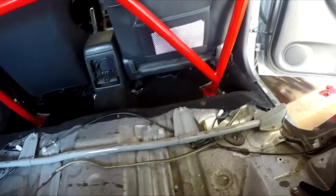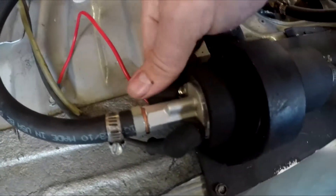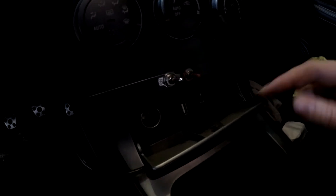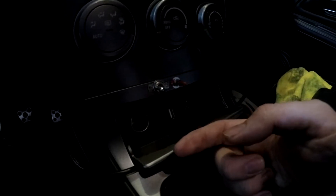When I got the car, it used to have an amp in it. So what I'm using to power the pump is just some regular positive and negative amp wire. I got an extra running off of the ground right here — just scrape the paint, get a nice connection, and ran the ground right there. I just have a relay switch in between the connection to the battery and the pump in the back, running under the carpet. Since I'm not super electrically inclined, I just did a simple switch. Flip the switch on, you can hear the pump start cranking. Then start the car, make sure the pump always stays on. When I turn off the car, just turn off the pump and I never have to worry about it.